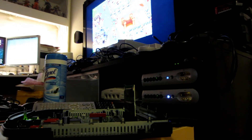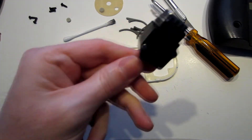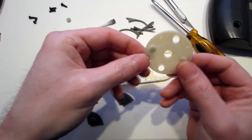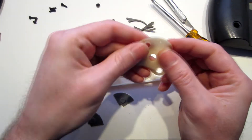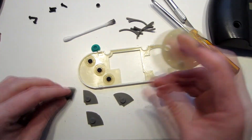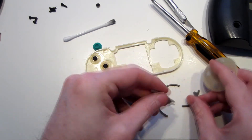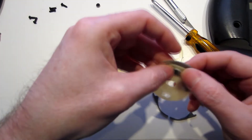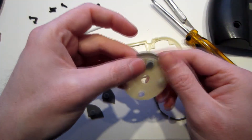We finally got some sound! I've also started to clean the controller. I already replaced the plug with a new one since the old one was really rusty. While I was cleaning the rubber membrane, one of the carbon contacts detached and I lost it in my sink, so I don't have any replacement. What I'm going to do is use a contact from a Genesis controller — I remove the border, cut it off like a pizza slice, and replace it since it's basically the same size. Hopefully this should work as a replacement.